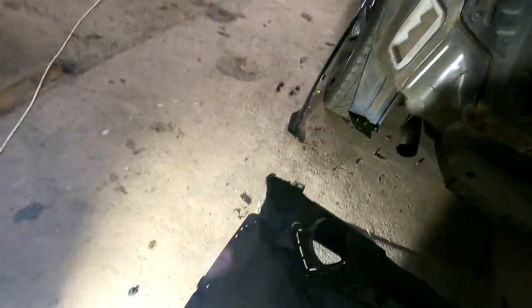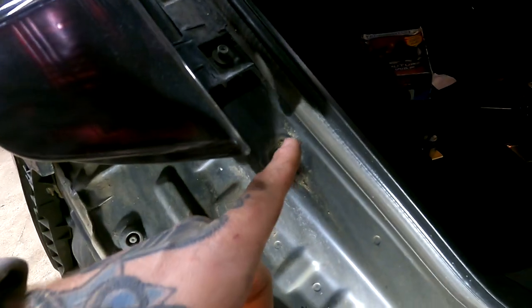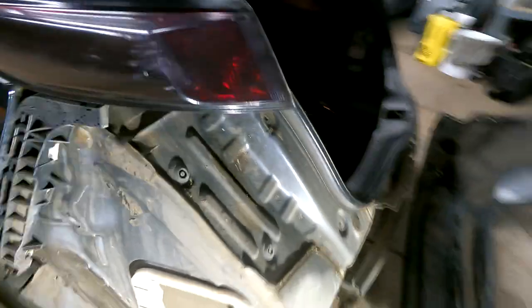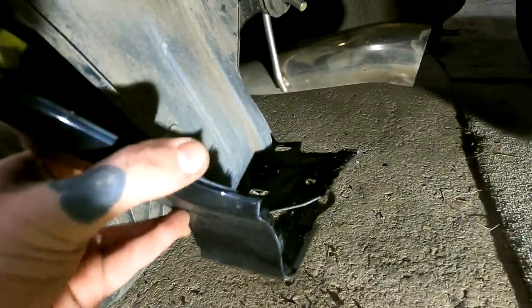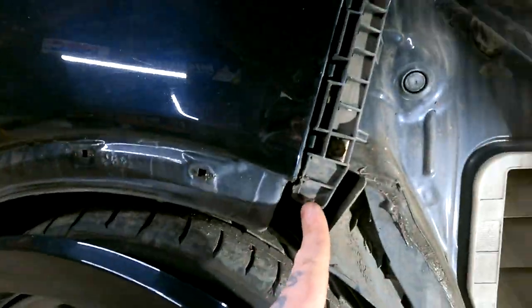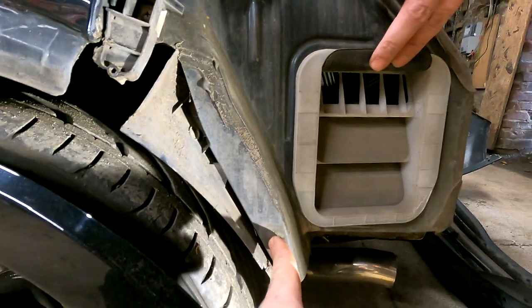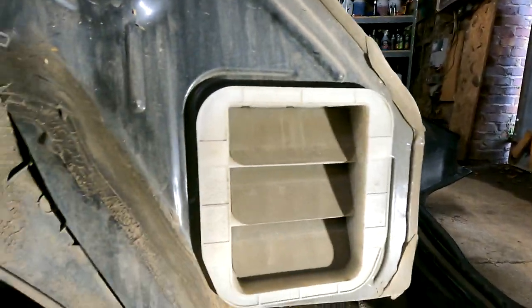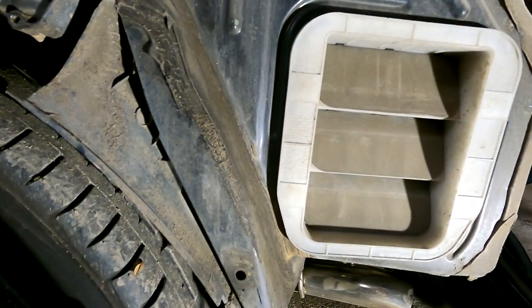Right, the bumper is off, so don't start up yet, Chrissy. All it is, you don't need to remove the lights, I thought you did. So it's one there, same on the other side. There's eight underneath that hold these on, which obviously then joins on with those. Then you pop the arch trim off, there's a screw there, and a push-in. There's little vents. And there's another one of them plastic bumper clip thingies in there as well. And it literally just slides on.